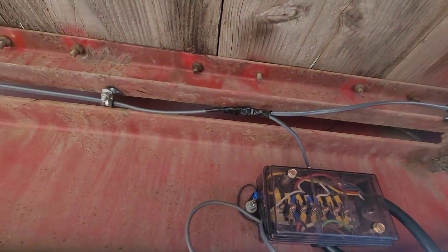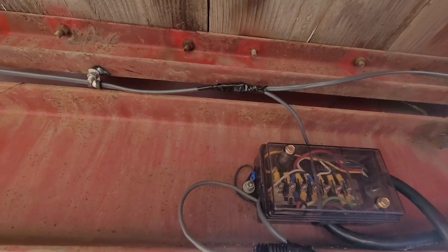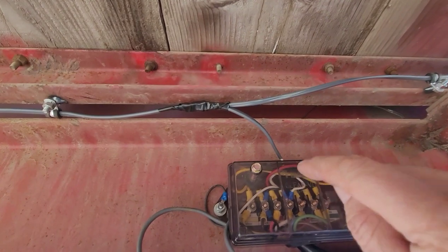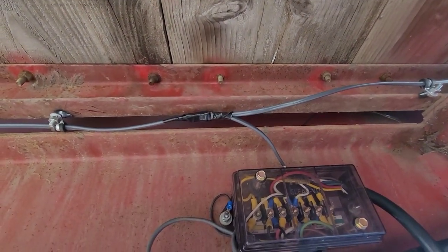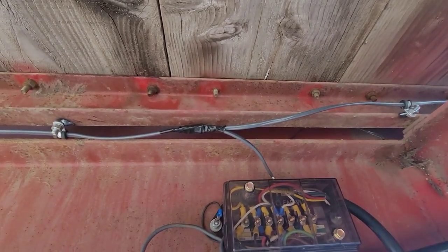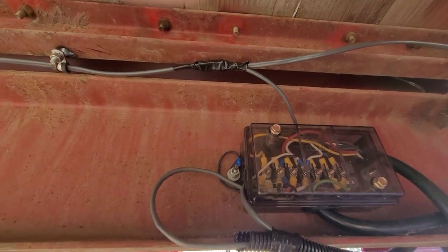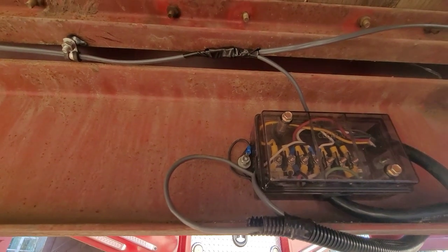Everything then can be, if I have a problem down the road and all of a sudden I'm blowing a fuse and I've got no clearance lights and I can't just quickly figure out where it's at, I can come over here and take all the eyelets off of the clearance light stud. And then I can one by one start adding each circuit until I blow the fuse again. Now I know which circuit I need to be chasing down. Because sometimes wires can be funny and it's hard to find that wire that's rubbed through in a certain spot.